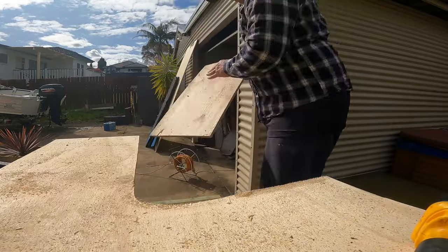Finished. A few modifications, little alterations had to be done. Just a few little tips: allow for the thickness of the carpet. So it's probably about 12 mil too wide on both floor panels. So I just had to take it off and skim 12, 13 mil off both sides on the edges. Not down the center, because that's already the factory clean cut, straight down the middle. But here it is, the end product. Just flick it around and...